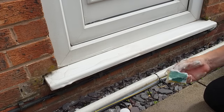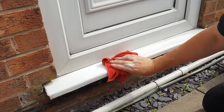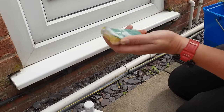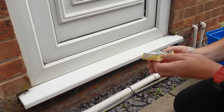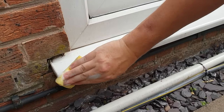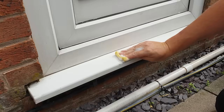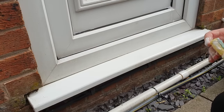We've come along here with the first pass. I'm gonna take that off with a dryer rag and you can already see how much of a difference we're starting to make. The abrasions are disappearing, the top surface crud is disappearing. We're gonna come back with another dollop — the sponge is always wet. Don't use the Rub Out on a dry sponge because it will take a lot more to work it in. If you use it on a wet sponge, it just goes further and it's so much easier to work in. We keep working it down along this bottom lip to get out those abrasions. It's elbow grease, elbow grease, elbow grease — I've got a right bicep like Popeye from all this Unger Rub Out.